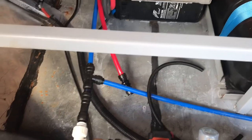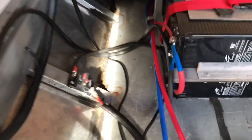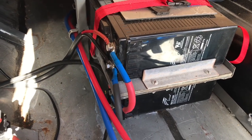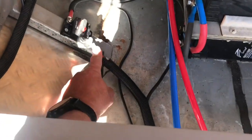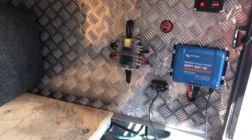That's the cold water line — we haven't plumbed for hot water yet, but I've got a spare line ready to go for when a hot water service arrives. Moving over to the battery system: two 150-amp AGM slimline batteries sitting on their side, which is fine as they're designed for that. They're bracketed in, with positive and negative feeding through a 40-amp master fuse. The main line runs all the way up to feed straight into the switchboard — that's how all the power comes from the positive side of that switchboard.